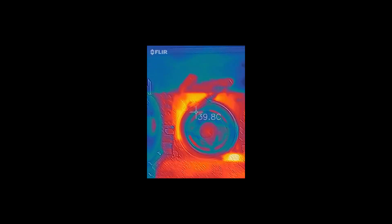Here we have the system at idle. Looking at the thermal imaging camera, you can see that's the intake for the fan — that's going to be the coolest part. When we look past the fan, there's the motherboard, the VRM, which is close to 40 degrees C — right around 41. We are at idle right now, so there's really no load on the system. We'll go ahead and put a little load on it and see what difference we see.